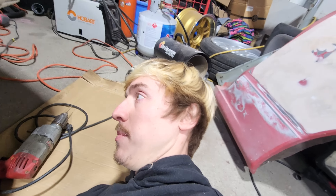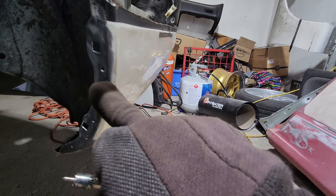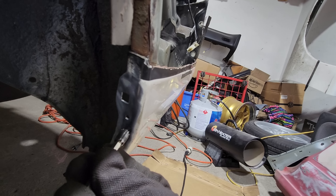With all the paint removed, you can see the spot welds much easier. I'm not going to go over this too much since I covered it in my last video with the quarter panel. But for example, there's one, there's one. And then what I do next is drill out a pilot hole so the spot weld drill bit can be centered. So I've drilled this pilot hole out already, and then the spot weld drill bit just sits right in there.